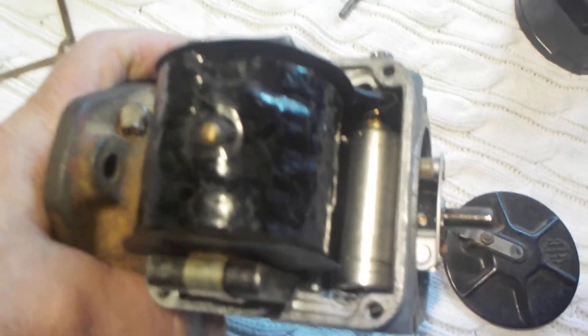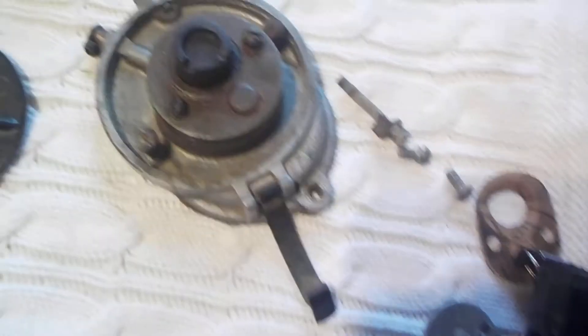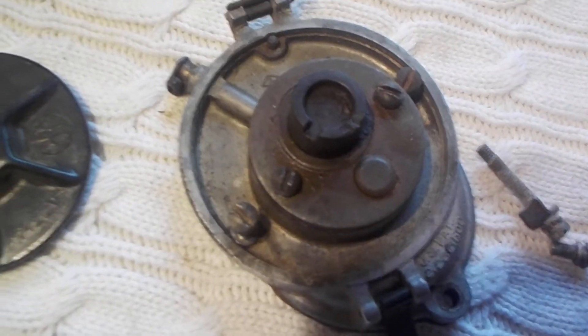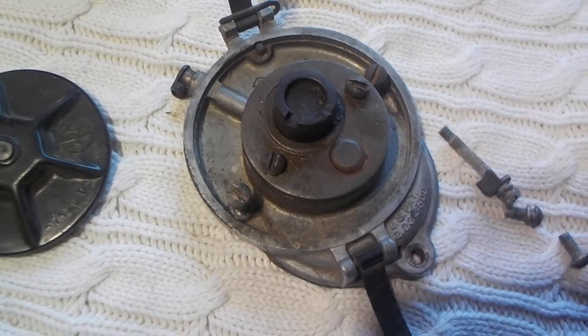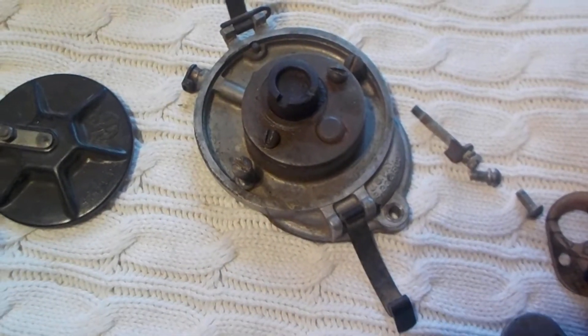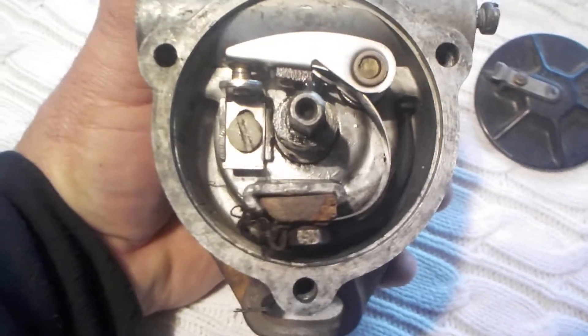Here's the inside — here's the coil. Look down inside there, you see the condenser. You see one wire here coming from the top of the coil down to the condenser. On the face side here, this plate you're looking at comes off. You see the two spring clips — the whole distributor cap comes off with three screws. The centerpiece there has gears under it. Unless you are opening that up for the purpose of greasing those gears or servicing them, I do not recommend disturbing those gears, because it can throw off your timing and screw things up terribly.